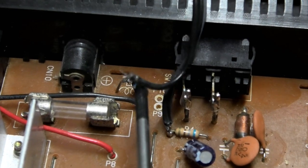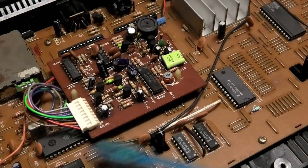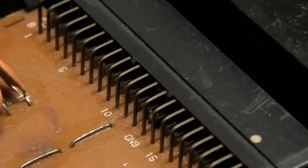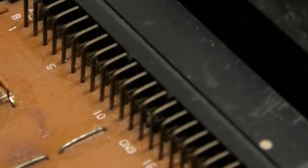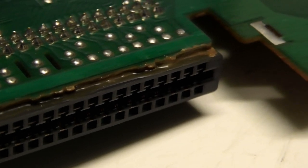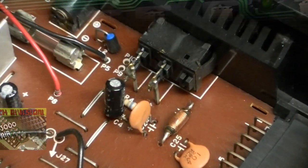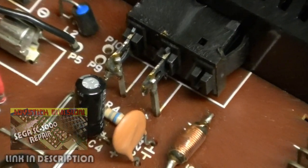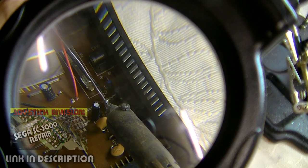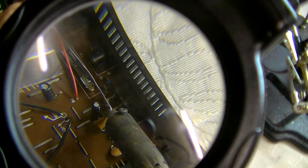There are also two wires soldered to the board to be aware of. She's a bit dusty so I break out the toothbrush to get that crap out. I'm also noticing that the cartridge connector pins are an odd colour - it looks like the connector itself is glued into place, as though it's had a connection issue in the past, like my other SC-3000. Probably a common issue. Now, interestingly, Sega decided to solder the power switch through the system's case, so if you need to get underneath the board, you need to de-solder and remove it from the case.